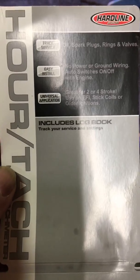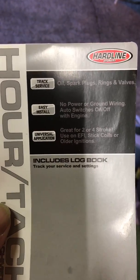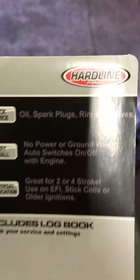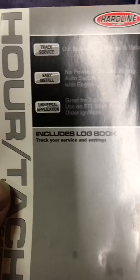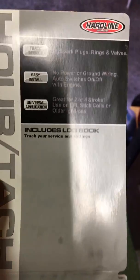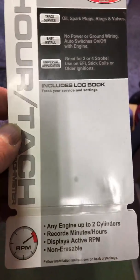I've gotten a lot of questions about the RPM and how to determine it. I've used a couple of different built-in tachometers on my equipment. This is the one I found has been the most durable, the most accurate, and long-lasting. I got it off Amazon — it's made by Hardline Products. It's an hour meter and a tachometer, and what's good about it is all the electronics are potted in epoxy, so gasoline isn't going to get into it, vibrations aren't going to bother it, and it's moisture proof.